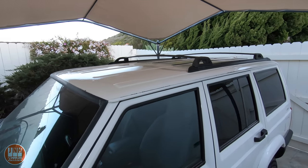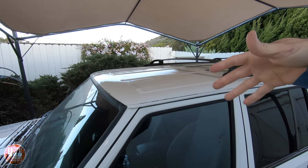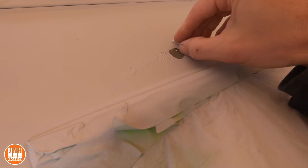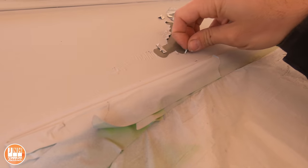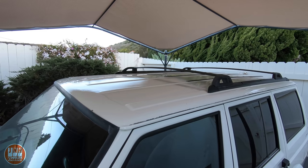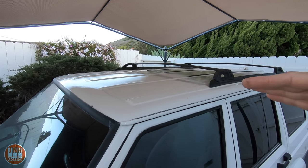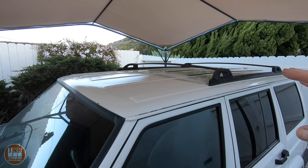That's not how it worked out. As I tried to prep the surface to repaint it, when I hit it with compressed air to blow it off, more paint came off — and then more and more. As I tried to paint it, the paint was peeling up over the edges. Whenever I sprayed new paint on it, it would soak in under the old paint, causing it to bubble up and come off. So the area that needed to be painted just got bigger and bigger. Then the weather was bad — cold and windy — so the paint wasn't going on well. The products I was using were probably fine and could have handled the repair if it had stayed smaller, but as the area got bigger there wasn't really enough in a single can of paint and primer.